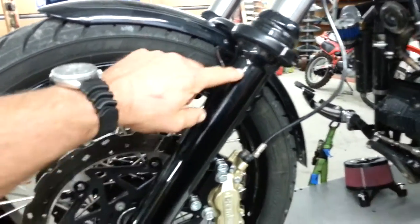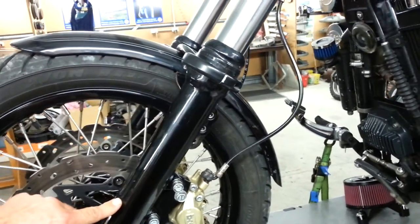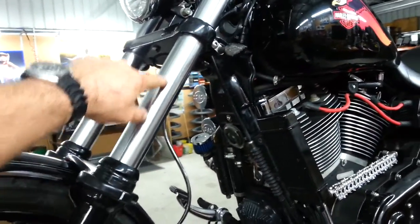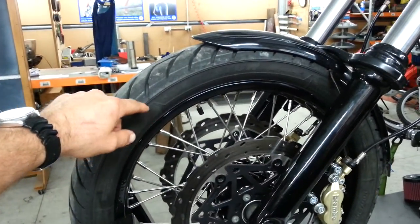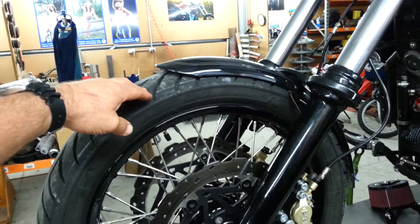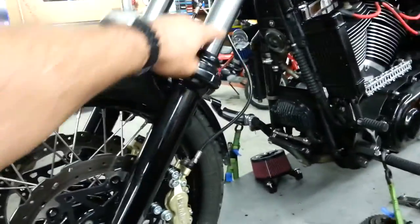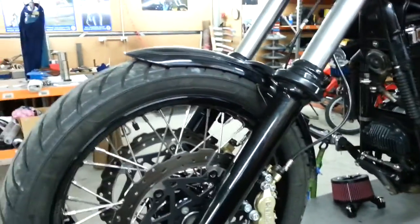It's brilliant. Used 2004 V-Rod lowers and custom chrome two-inch-over tubes. The reason we went two-inch-over is we ended up putting a 19-inch aluminium front wheel on it. I wanted to get a wider tire, get more tire on the ground. Because we're taking the 21 off and putting the 19 on, we lost a bit of ground height, and I want to keep as much clearance as we can, so the longer tubes gained a bit more ground clearance, which is bloody good.